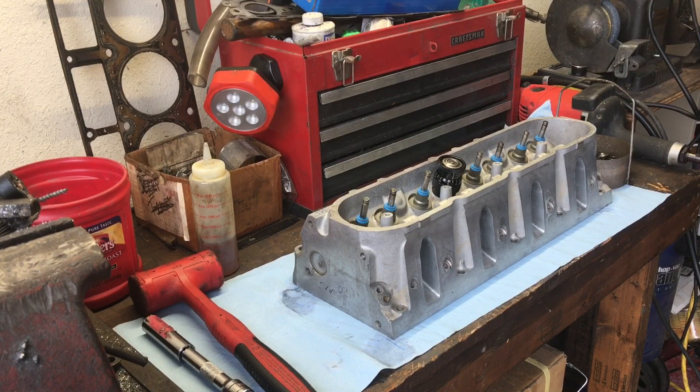Check from there to your fully extended or raised valve spring retainer with locks, get it as tight as you can without hurting anything, and always verify the installed height that those valve springs are going to be living in. That way you know you've got the seat pressures, operating pressures, open pressures, etc. that will make this engine run and perform like you had planned. This one is coming out right at 1.802" — those springs are intended to be installed at 1.800" — and every one coming down the head is between 1.801" and 1.803". That's going to be perfect.